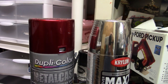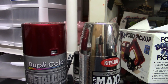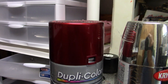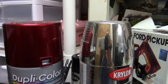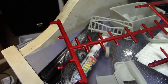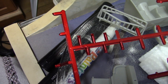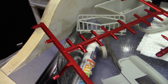What I've been doing is testing base coats — base silver coats. As it turns out, anything you paint with chrome paint and then paint with the anodized red just turns it a dark blood red — it cancels out the chrome. But the silvers work. The overall winner is the Krylon Max as a base coat for the anodized red. That is what the frame is going to look like — the whole frame — and it's going to be something else out in the sun.